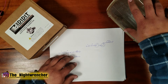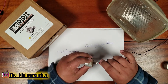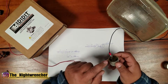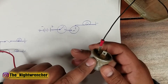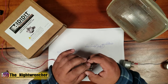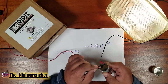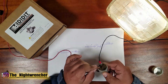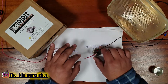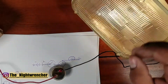Now let's build this circuit out. We have our headlight already grounded, and the positive wire leads into the high beam circuit. We plug this into one side of the flasher — it doesn't really matter which side. Then we take the positive wire and contact the other terminal directly. The aluminum can is isolated from the circuit so there's no chance of getting shocked by holding the cover. Applying power, you can see the system working just like it needs to, and you can hear a faint clicking. As long as power is transmitted through the flasher relay, the light will continuously flash on and off.